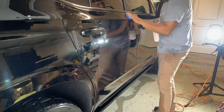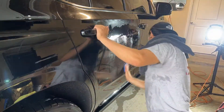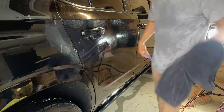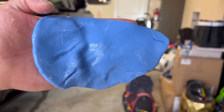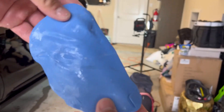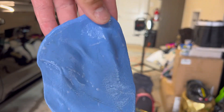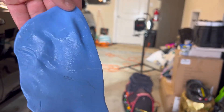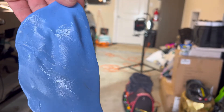With the clay, you've got to make sure that you don't move on to the next spot until that paint is smooth. This is why you want a clay bar — all that stuff coming off that the regular wash didn't take, the clay bar will get it.